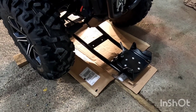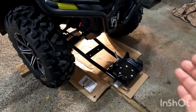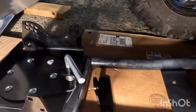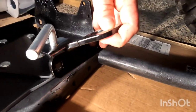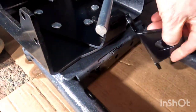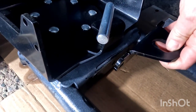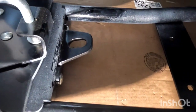So the push tubes are all mounted underneath. I'm surprised that it doesn't seem to stick out very far in the front. So what we're going to do next is install your winch cable lift bracket. This is going to mount right here with two bolts — 16 millimeter. You can either put it down like that; I'm going to put it up like this. So we have the lift bracket installed.